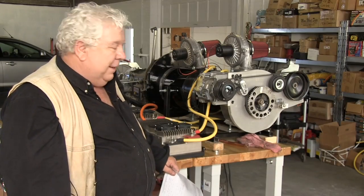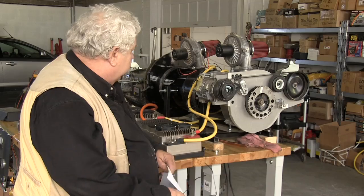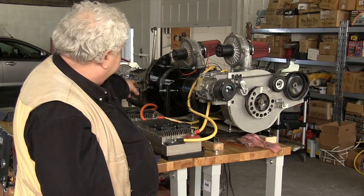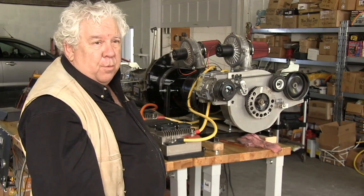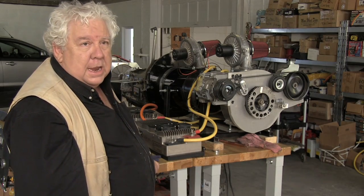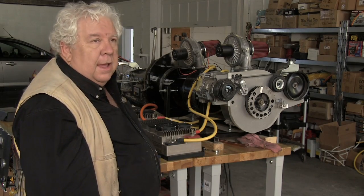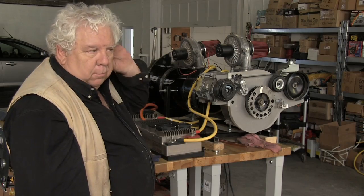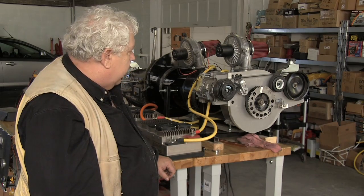Here we are at our test bench. This is where we have assembled a mounting system with our two 11-inch motors, an adapter, and our transmission. That's kind of the backup transmission for this project. It's made by TCI, and it's kind of a super-endowed 4L80E that's pumped up to do six gears and manual shifting, with a tunable controller. We want to use the transmission that's in the vehicle, the 6L80E, if we can pull that off. And there are a number of aspects to that.